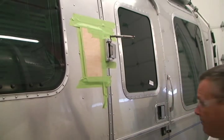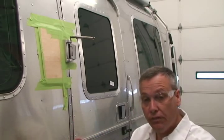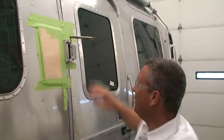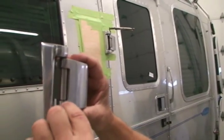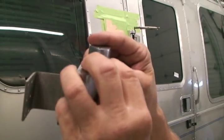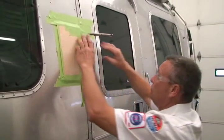It's going to come right out of there. The next step is to make sure my door is shut and that nobody is walking around on the inside of the unit. We're working on the metal and I don't want anybody rocking or moving the trailer, which could cause me to slip. There are little washers in here, and if you look in this hinge you can see the washers — one here, one here, and one on the bottom. Right in the center is the C-clip. I want to make sure all those washers stay in there and are oriented in their proper spaces. Just real careful, make sure my door's shut.